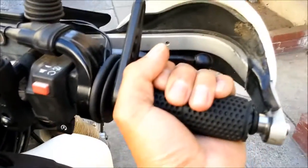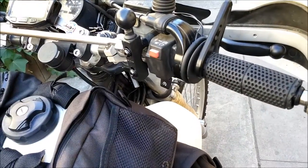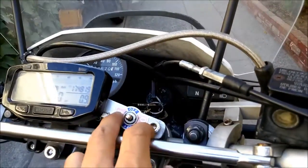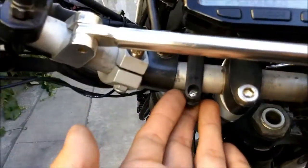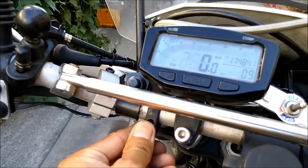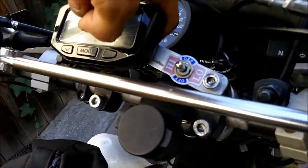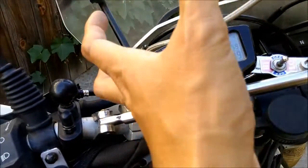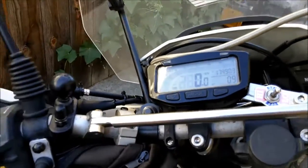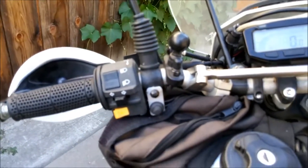I have rally gel grips — actually I don't like these, they're too thick for my hands. They are heated grips with a high and low mode switch. I use this bracket to also brace my Trail Tech so it's nice and stiff — the Trail Tech mount only clamps on one side of the bars, so I built a support that bolts to the other side. I also have two RAM mounts — one for GPS and one for a cell phone, so I have two forms of navigation.